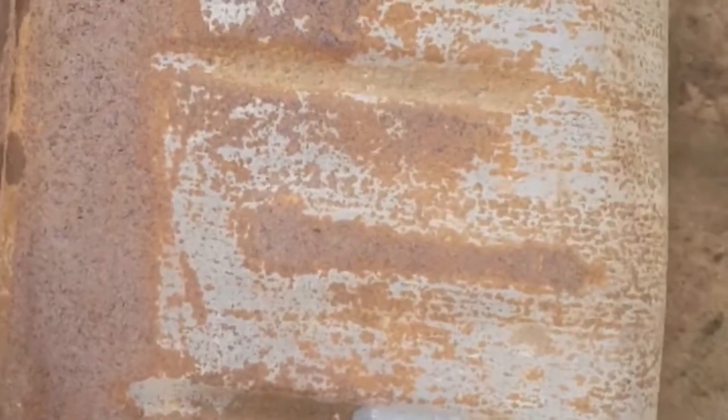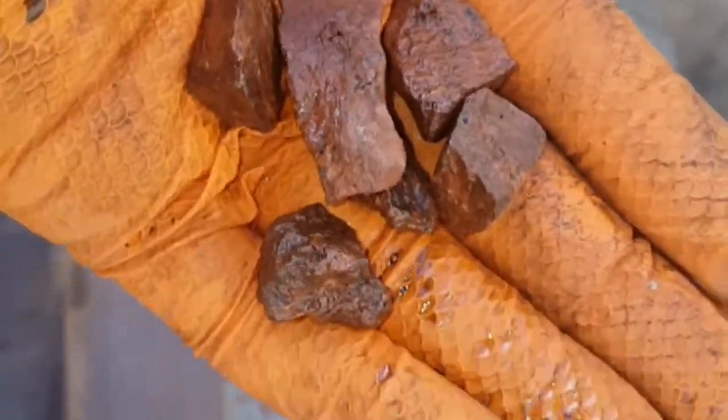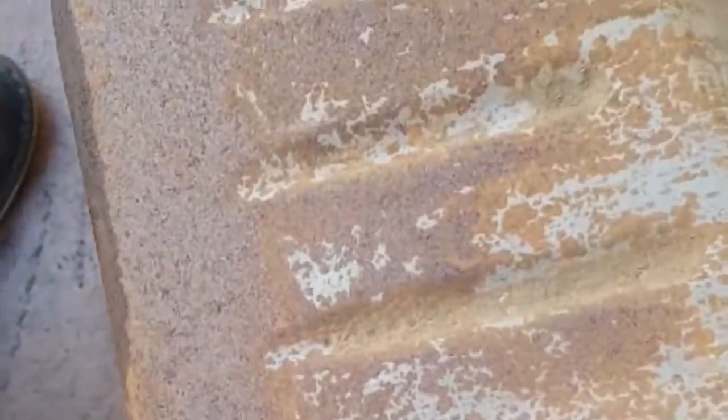If I hold this close and move it around, I'll be able to hear the dirt - you've got the lovely noise of all the rubble moving around. Just to go with the DIY idea, this is a way a lot of people do this job DIY style. You basically want to get all the surface rust off inside the tank that you'd normally get off with a wire brush, but you can't quite get access to it, so you chuck some stones in - little shingle - and shake it like a maraca for a few minutes, then tip it out and see what else you get out of it.